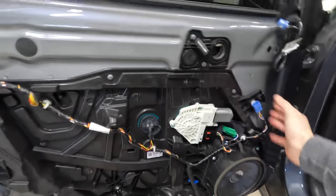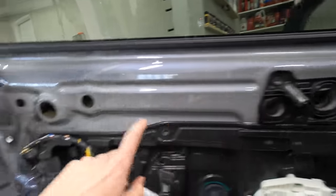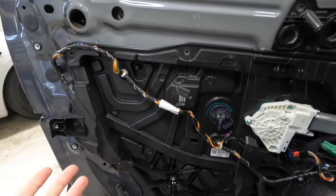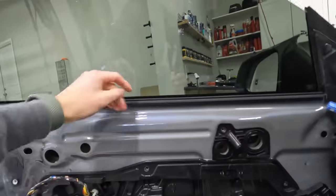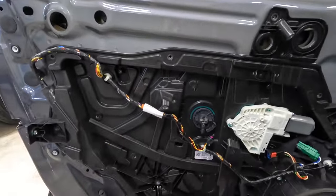I removed the pull strap tab and disconnected the mirror wires. I also watched a great YouTube channel — I Want Tesla — who took this exact door apart. I learned I need to remove the glass first. To do that, mark where it goes, unbolt here and here, and the glass slides out easily. The window regulator attaches to the glass assembly, so unlike the Model 3, this comes out as a complete unit — much easier.